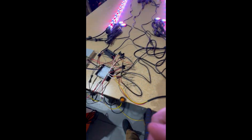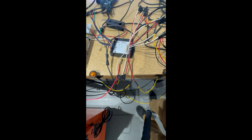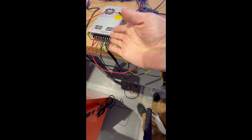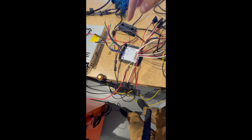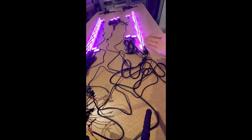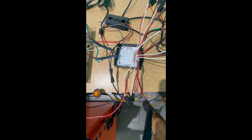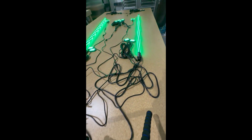The goal is we have a case for this that we'll fully resin so it's completely waterproof. You'll have leads coming out to tie into your machine — run the data line in from your controller, and run positive and negative to a power source, which for me is just a small AC-to-DC converter. You'll have a channel for your whips, a channel for rock lights, and a pass-through channel — so you can put a 4-piece, 8-piece, or 16-piece rock light setup on the pass-through so they don't get interfered with by turn signal or brake.